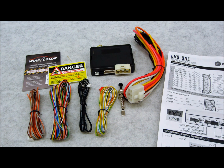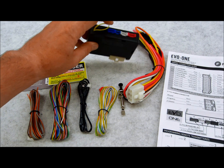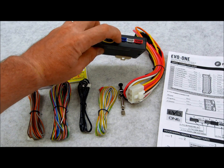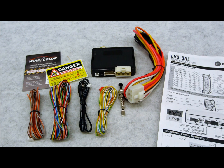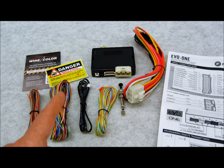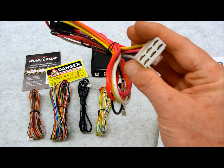With what you see right here, you have the ability to add on an RF kit — which in plain English means through this four-pin plug you can add on a two-way or one-way remote control, whatever you want. You can use the drone system so you can use your iPhone or Android as your unlimited range remote control, and also use GPS, all built into this little unit.